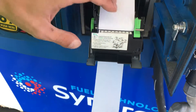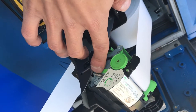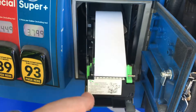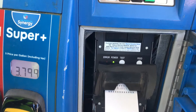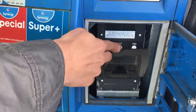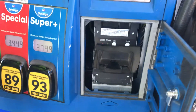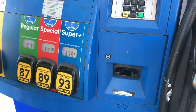The paper should feed in easily. If it doesn't want to come out the other end, something may be blocking it — don't try to force it too much. Once it has pulled through and comes out the other end, close the lever back up and pull some paper through. Close the door back up and it will automatically print a test receipt. If it doesn't, you can hit the test button and it'll do one again. Always make sure you close the door, and that's how you change printer paper at the pump.